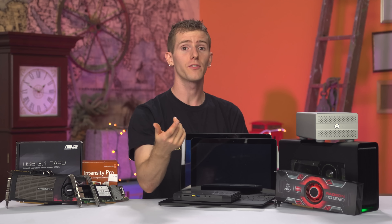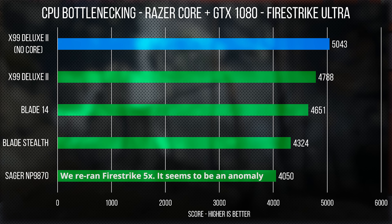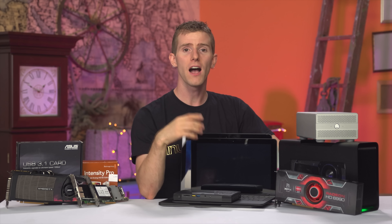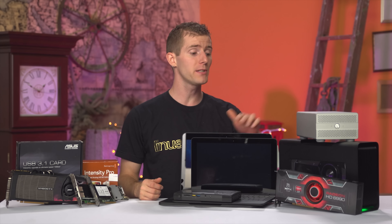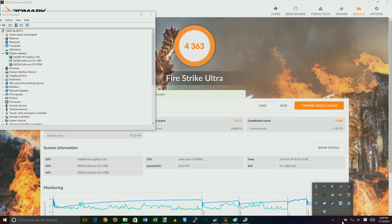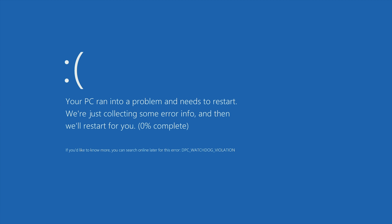Also of note here is that the 6700HQ holds its own head-to-head with the last-generation 8-core Extreme Edition, except in extremely CPU-bound titles like Cities Skylines, pretty darn well. As for the dual-core 8GB RAM-equipped Stealth, I would expect that to lag behind a lot faster, and I probably wouldn't recommend pairing it with a top-tier GPU in the Core. It appears that the performance hit more likely comes from the overhead associated with converting from PCI Express to Thunderbolt 3 and/or making PCI Express a hot-pluggable interface — something that, on Windows anyway, it is definitely not designed for.